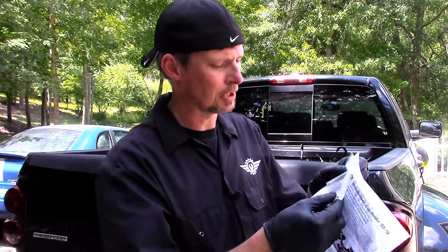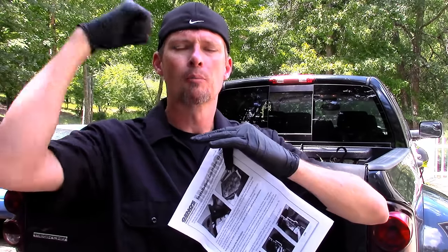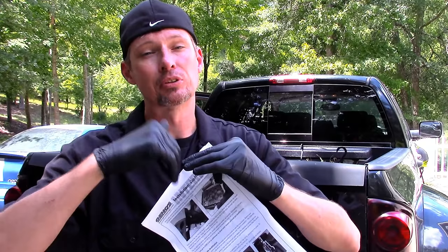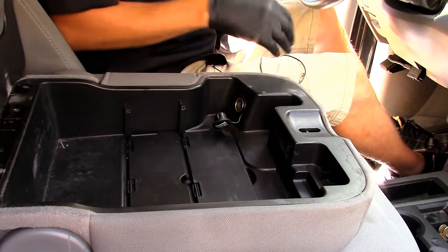The kit comes with a detailed set of instructions. Inside there's a plastic bag with some washers and Phillips screws. The Phillips screws are used to attach the cup holder assembly to the inside of your storage compartment so it's permanently mounted. The washers are needed to adjust the latch, because we're sandwiching something between the bottom and top portions of the center console. If you try to latch it without adjusting, you'd lock it in a position you couldn't unlock. Make sure you adjust the latch using the washers first before doing the final shut of the console.